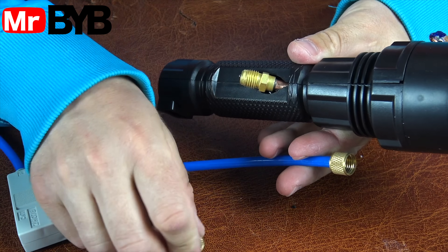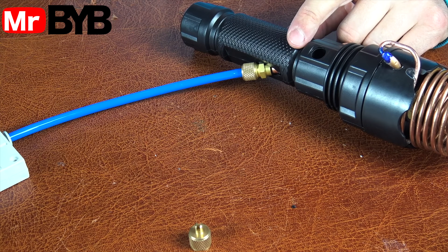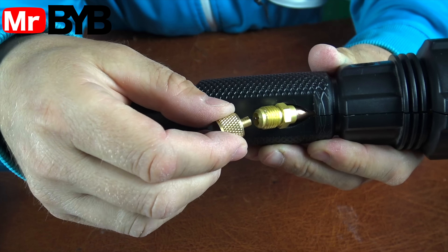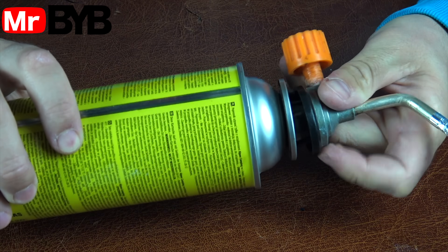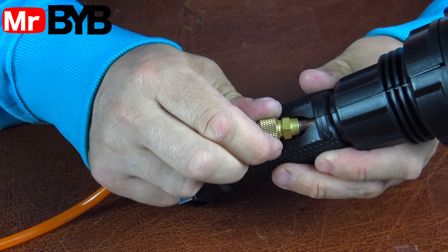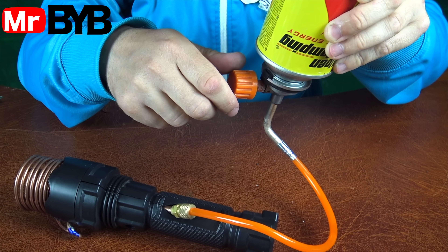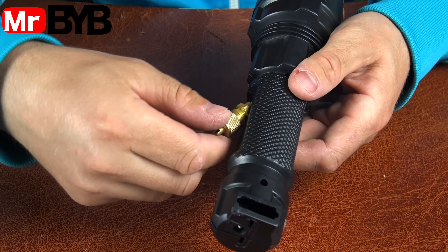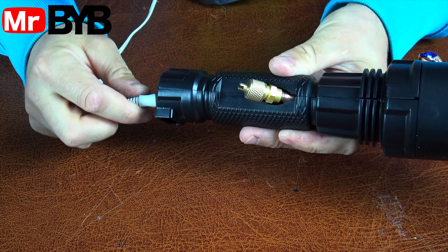The final and probably most important step is properly charging the air conditioner. But before that, we must vacuum the system. Vacuuming is the process of removing all the air and moisture from inside the system — we literally suck out everything, creating a true vacuum. Only after that can we charge the system with refrigerant correctly. Air inside the system reduces cooling efficiency, interferes with the refrigerant flow, and can even damage the compressor. Plus, any remaining moisture can freeze and block the capillary tube. Fun fact: the deeper the vacuum, the more refrigerant you can fill under the same pressure, which means better performance — even in a tiny DIY air conditioner like this. So remember: no vacuum, no cooling.